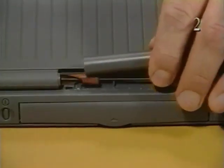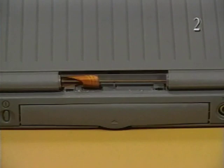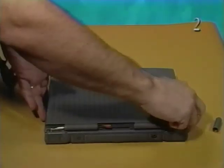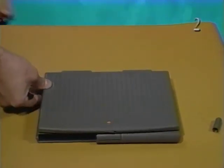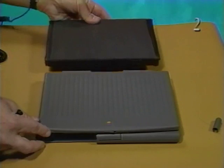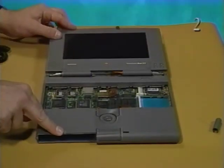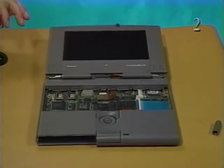The clutch covers are easily damaged during removal. These are considered disposable and can be replaced as a kit. When removing the display assembly, use caution to avoid tearing the display cable. Open the display so that it lies flat. Be sure to support the display from beneath with a flat object, such as a 1/2-inch book or box, to prevent unnecessary stress of the display cable.